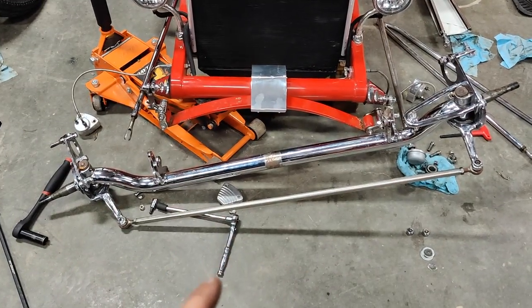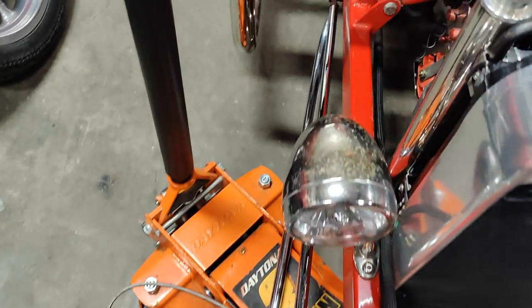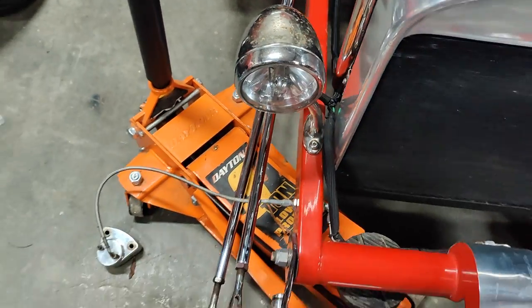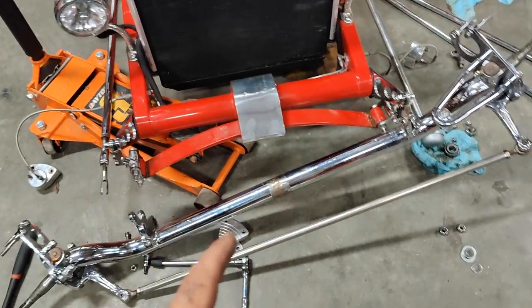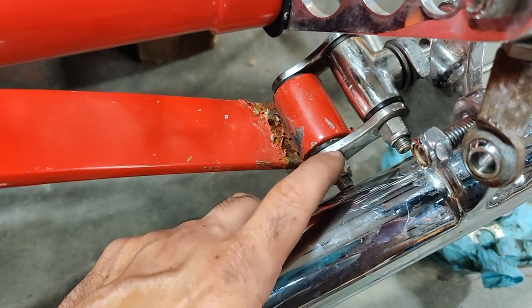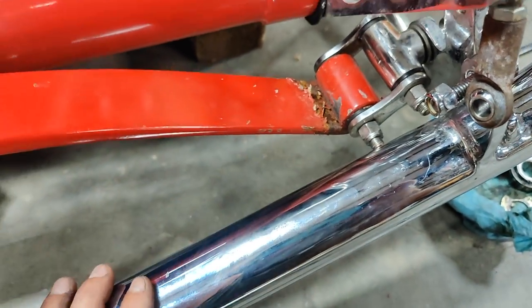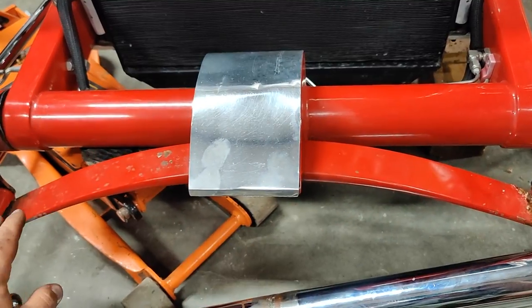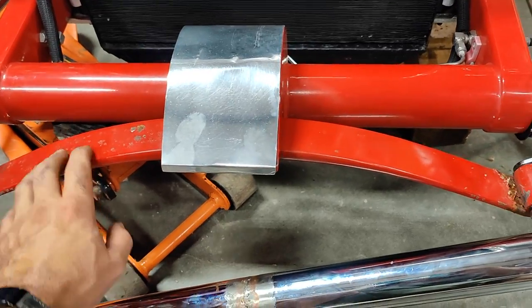The axle is now pretty much disconnected from the car. This is the passenger side radius arm — as far as I know the threads aren't stripped on the back, but I got a new pair to replace both at the same time since this heim joint is clearly bent in the same way as the other side and it's also still half-inch hardware. I figure it's better to replace them both. Also, I think these are probably in backwards or too long because they're interfering with the axle, so I'm going to flip them around. I also got a chrome leaf spring to swap in while I have everything apart.